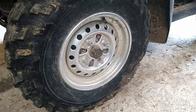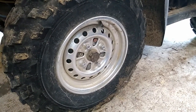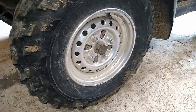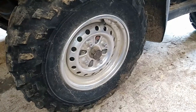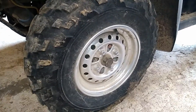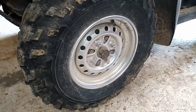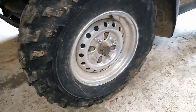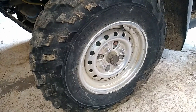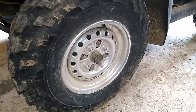With the new angle sensor in, it does seem to shift and do what it's supposed to do. No flashing display screen — I actually get the information I need on the dash: neutral, drive, low, reverse. Before, sometimes I wouldn't get any of that and it would just flash a blank screen with no letters. It seems to be working now. Thanks for watching — please like and subscribe.